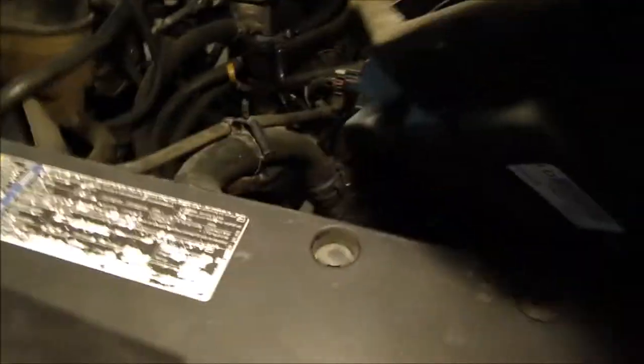There's the air filter box, and as you can see there's the filter. It's a little dirty — probably hasn't been changed in a long, long time. You can kind of keep this if you want or you might sell it. But make sure you keep the bracket and unscrew it — don't break it because you will have to buy another one.